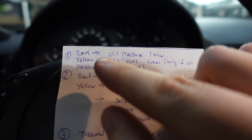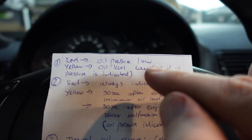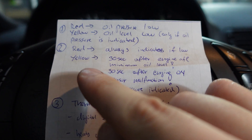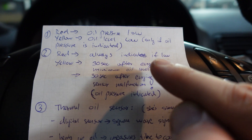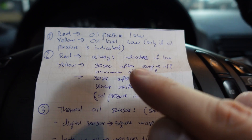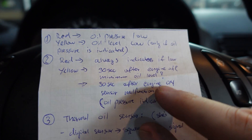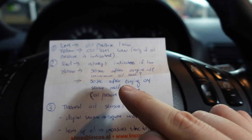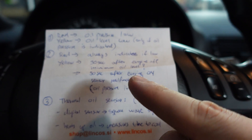The second mode is the yellow light, and the yellow light indicates oil level — if the oil level is too low, the yellow light will appear on the dashboard. If it is displayed 30 seconds after you shut off the engine, then you have an actual low oil level and you should top up the oil. But if the warning light comes on after you start the engine, that means there is a sensor malfunction. In my case the oil light goes on after I start the engine, which means I have a sensor issue — not an oil level issue.